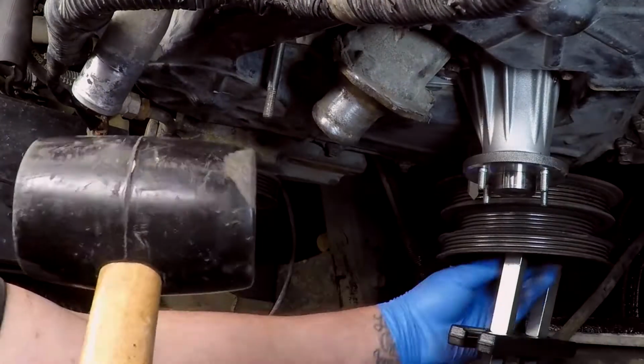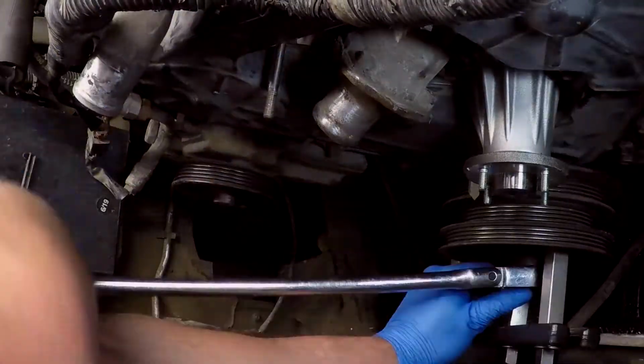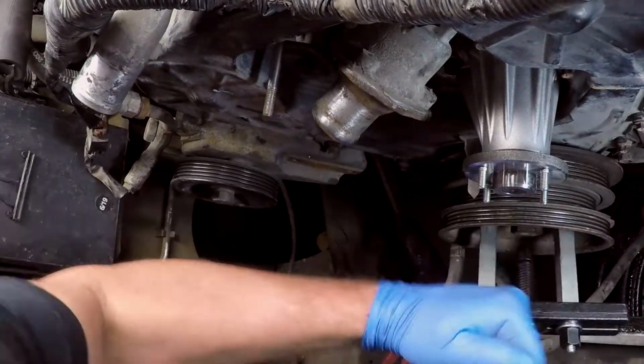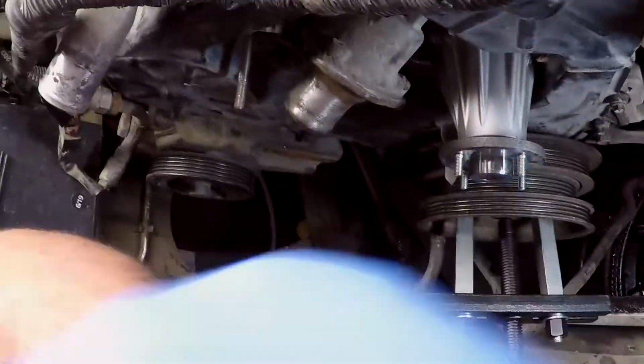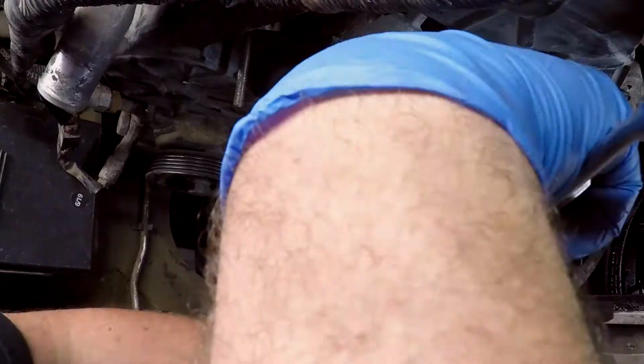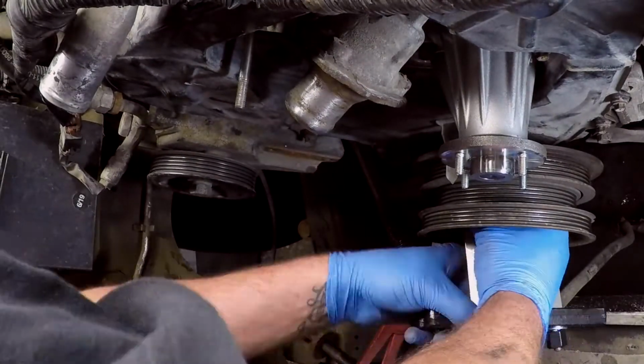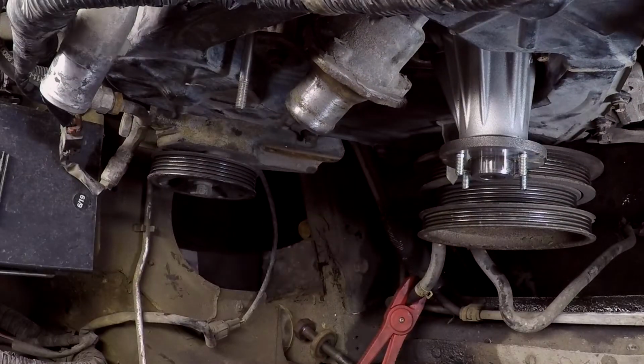Next, you're gonna wanna be putting on the crankshaft pulley there. Just use the bolt to tighten her down, and then right after that, take it right back off because there's a bolt in behind there that you forgot to tighten, and it's scratching up at the back of the pulley, making a loud squeaking noise. So once you tighten the bolt that you left loose, then you want to be putting this all back together, finagling and fumbling with that stupid whatever that thing was, and tighten her up there.